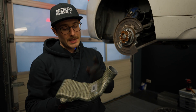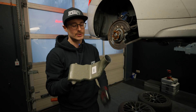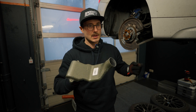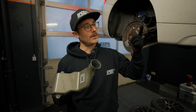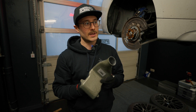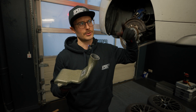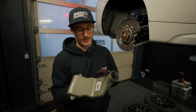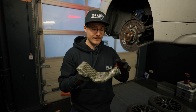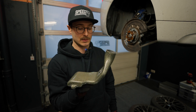These are brake ducts made of a hybrid version — Kevlar carbon. First things first, we are producing some of the kits in plastic. It depends on the environment, because especially in Germany the cars are driven during winter and summer with water and salt and everything else inside the wheel housing, meaning the environment is not that good. We tested plastic for a long time and it is not perfect, especially in the long term. This is why we switched to carbon fiber — but not only carbon fiber, this is Kevlar carbon. The reason is that Kevlar doesn't have sharp edges if something breaks. This is why we are selling them only in Kevlar carbon and not in plastic anymore.